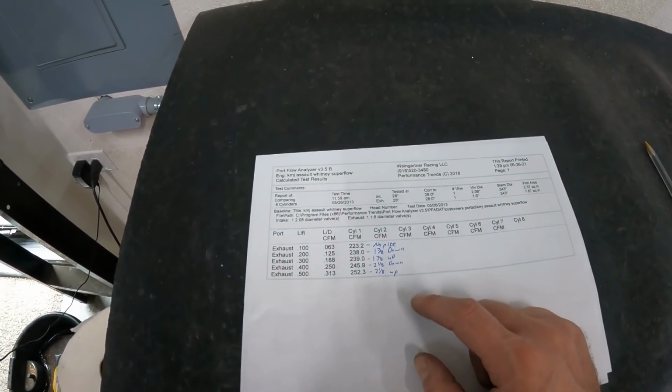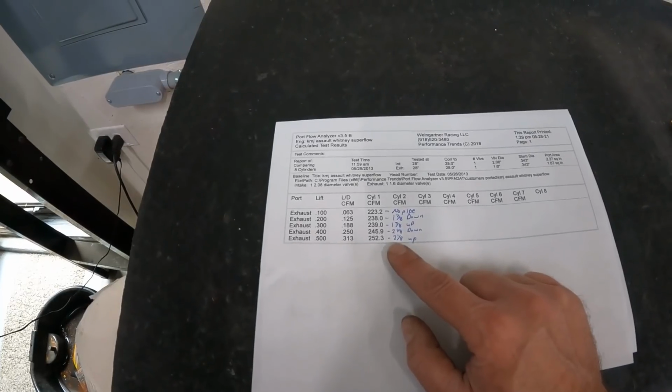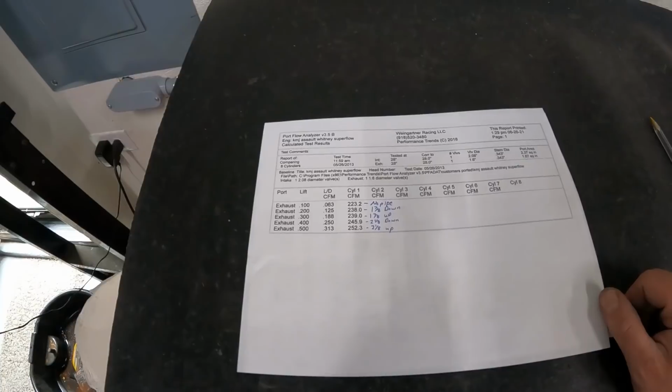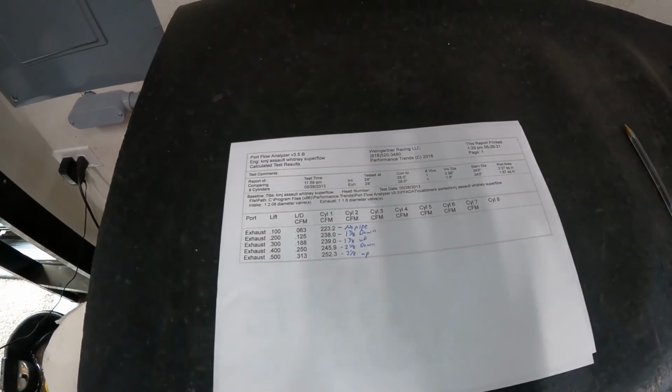I could do a whole other video on this, because it still applies to boost stuff. If you don't have enough pressure with the bigger exhaust pipe, it's not going to spool the turbo, which means you're going to have a long turbo lag until you can get some RPM. But anyway, this stuff applies to engines using exhaust systems. Maybe not entirely the same way or as much, but they're all applied.